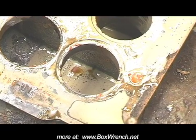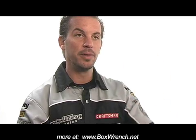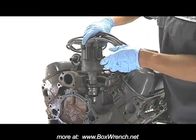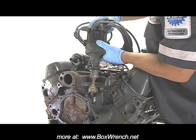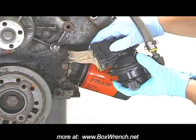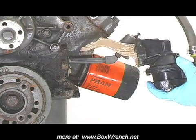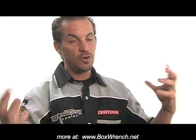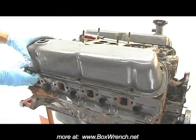We're like, okay, obviously there's some water getting mixed in with the oil somewhere, and it was getting sucked through the PCV valve into the plenum. So we start taking things apart — the distributor comes out and there's this ice cream-looking stuff on the gear of the distributor. Pull the fuel pump off and the fuel pump lever has got that same stuff on it. It's like in the engine everywhere.